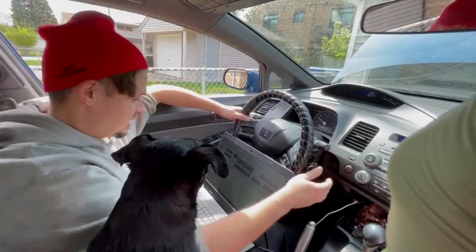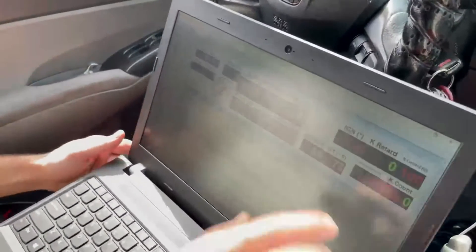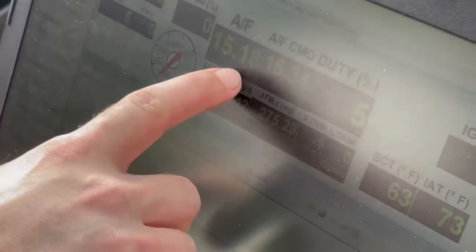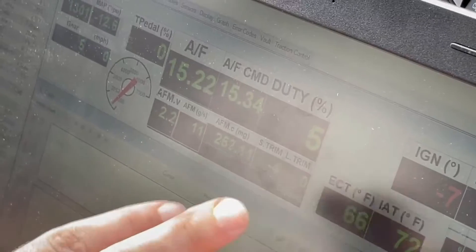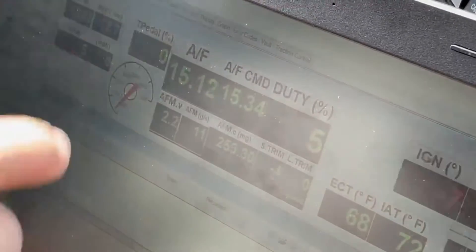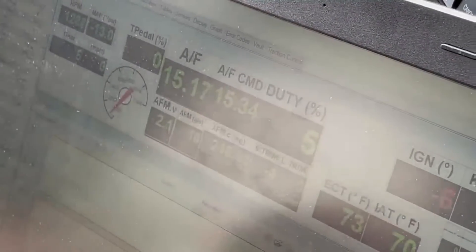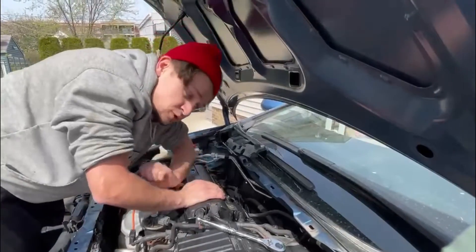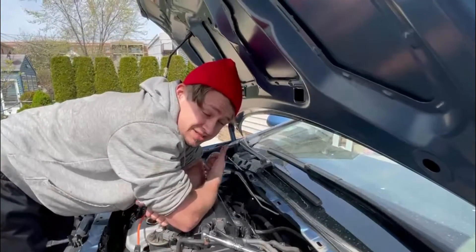That's a little rough but she got it going. Looking right now at the tune — once we go to closed loop we're going to be watching our air fuel ratios and seeing if they're good. Right now it's getting a little lean in closed loop; it's running okay, a little shaky at idle. We're just going to let it run. It's working — idles a little rough. Let's go check for any leaks. It is running a little leaner than usual; the tune might be affected slightly from the difference in injectors. Everything looks okay — I don't see any leaks. We'll let it warm up and lubricate the injectors a little bit.